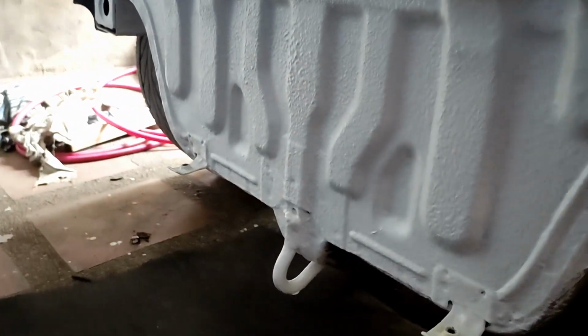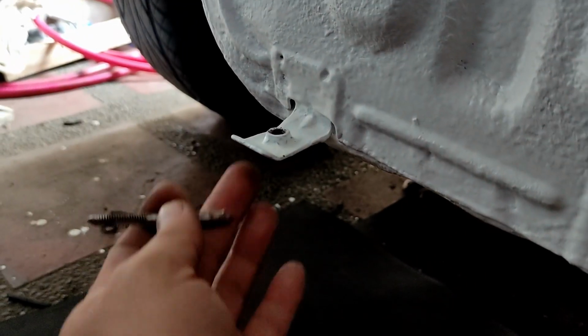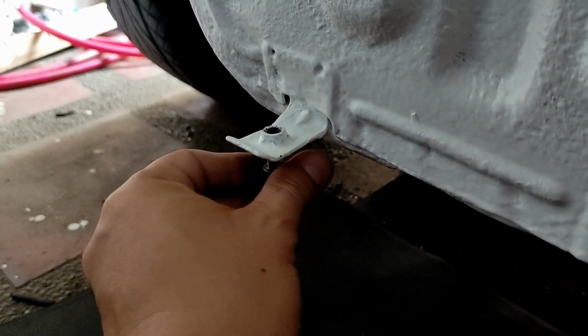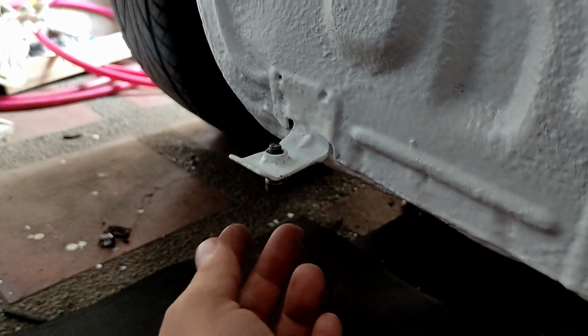So the rear bumper is sitting right next to me on the EcoSport. Crappy Ford EcoSport. So I don't have any other options. I can't look for the OEM bolts. I just bought a rethread M6 tap, and this one I'm all set on, and the M6 can go all the way in. So in short, I converted all the rear bumper bolts or nuts to work with M6.